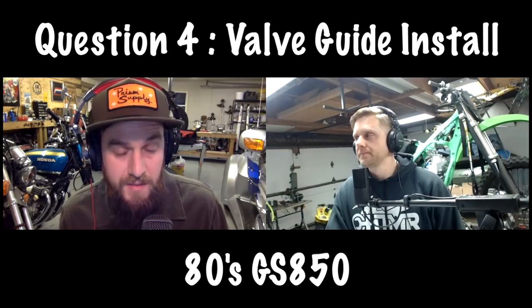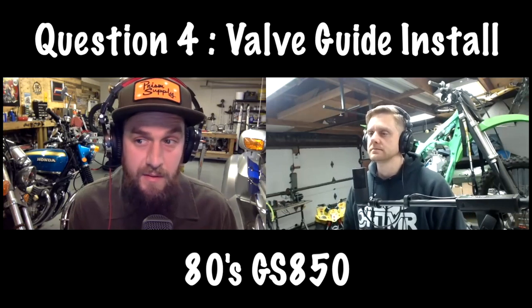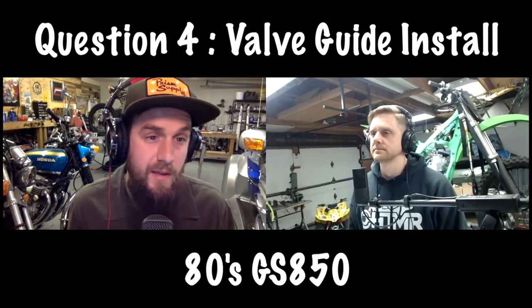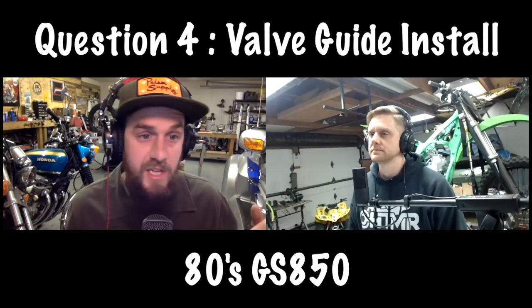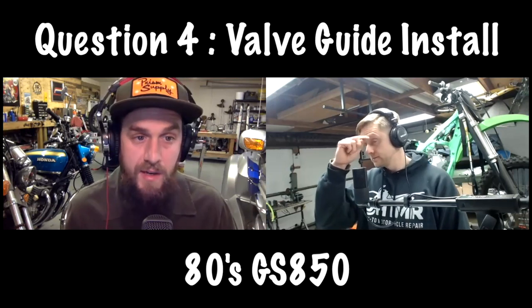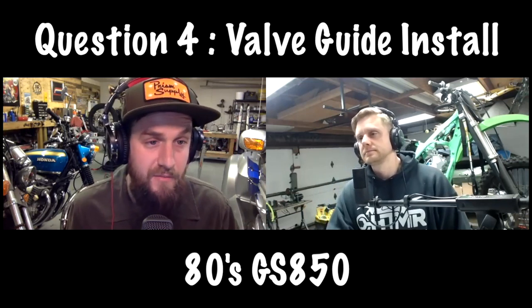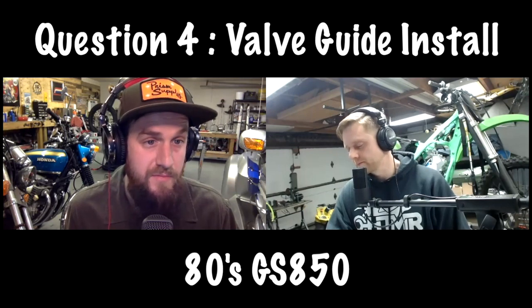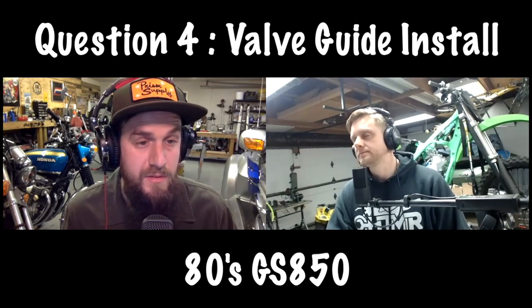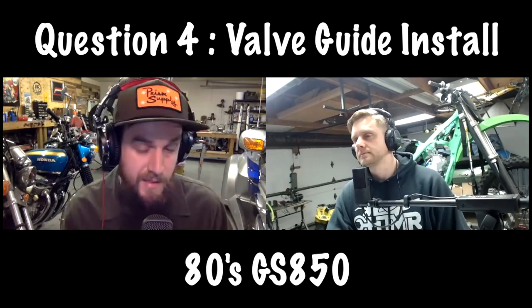Yeah. Unless it's like an old bike, even then. I mean, I've never had to do that yet. I've never rebuilt old motors to the point where now I'm doing this guide job, doing this seat job, getting them recut. People don't have enough money to have me do that. You know what I mean? So on newer stuff, dirt bikes, four wheelers, all you're doing is just replacing the head, and that's what it comes with. But that's not his case.